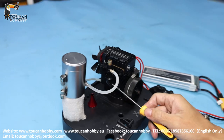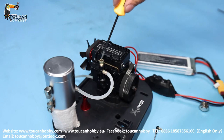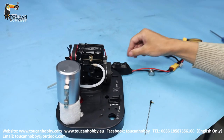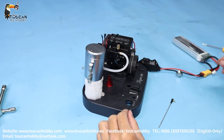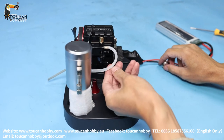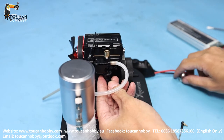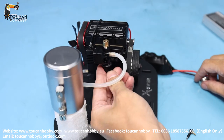So now this auxiliary oil needle is closed. Main oil needle, it is cracked open. So I will only adjust this one. Cracked open, closed — all can start, but if you want to maintain running well-conditioned and very low idle speed, you have to adjust slowly. Let's start. Close a little bit, this only cracked open. This is closed, this is full open — let's try.